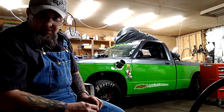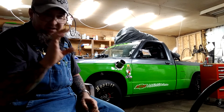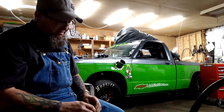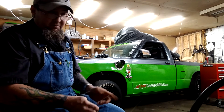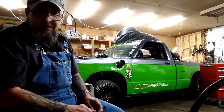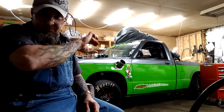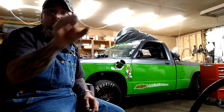I used the Camaro headers. I believe they were the H8012s or 8013s, whichever one's the bigger tube. One's I think 1.5 inch, one's 1.7 inch. Patriot, Clipster, or short, mid-length, whatever you want to call them. Headers on it, but you do have to do a little trimming behind the driver's motor mount where that front tube comes back and then it drops down.